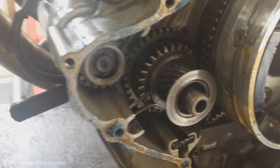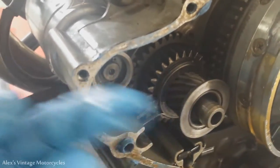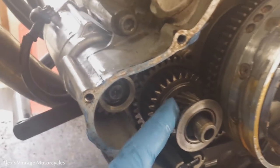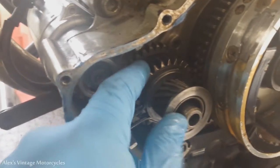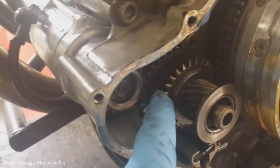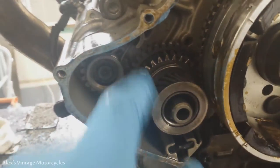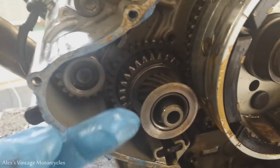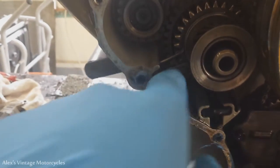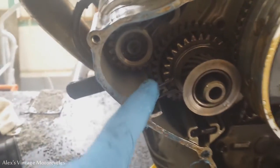Normally this is how this gear goes in: you've got this little clip on the outside facing this way, and the starter hits this gear, spins this worm gear type of deal, and throws it out into the flywheel. You can see these edges are all chewed up here. We can literally pull this out and flip it around and there's enough space — they pretty much engineered it to be reversible because all the spacing is the same.